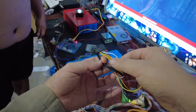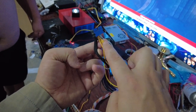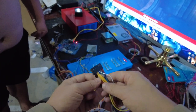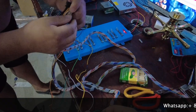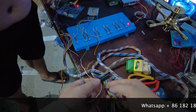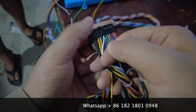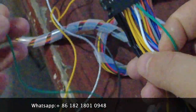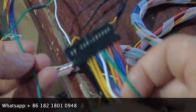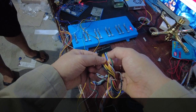So you have to be sure: the four black cables must be ground, and the four yellow cables must be 12 volts. And also we are supposed to be sure the other cable — positions 1, 2, 3, 4, 5, 6, 7, 8. Number 8 of this connector on this harness must be the SSR cable — the green cable. This cable must be on position 8 of this one. So to summarize: the black for ground, the yellow for 12 volts, and the green for SSR.